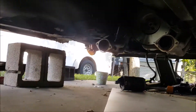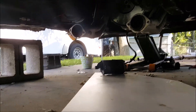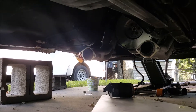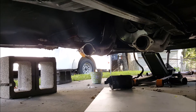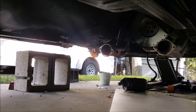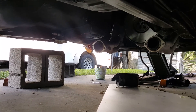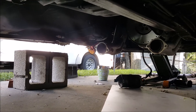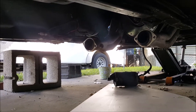Underneath the car, I've already got the flywheel mounted up and cleaned. I'm going to clean that one more time with some very strong brake cleaner. Anytime you put a flywheel on, make sure that thing is clean, clean, clean — because they ship it to you in this nasty grease and you just don't want that stuff getting on your clutch. It'll ruin it if you try to drive with it on there.